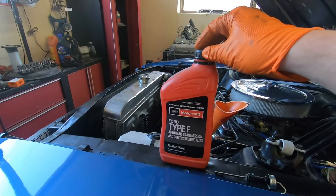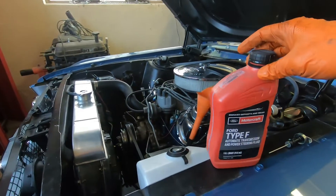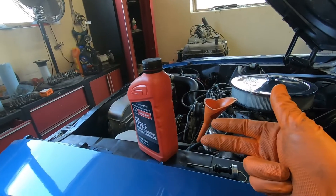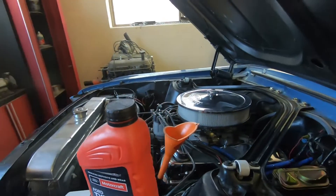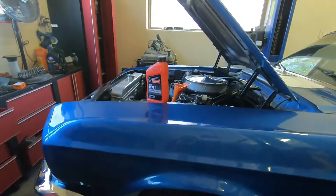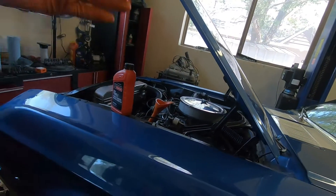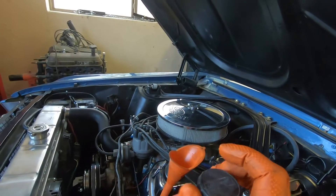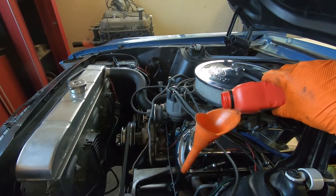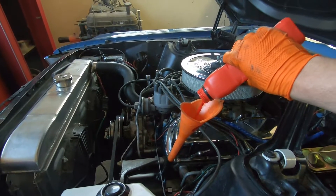When you're ready to fill your power steering system, this is very important and applies to any type of repair on your power steering system — whether it's a pump, a hose, the cylinder, or the control valve. You're going to have some air in the system and you've got to work that out. I recommend getting the wheels off the ground so the load of the vehicle is off, and the system is unrestrained so it can safely purge all that air through. The only fluid I recommend is Motorcraft Type F. If you can't find Motorcraft, it's got to be Type F — but Motorcraft is the preferred fluid of choice.